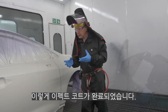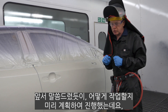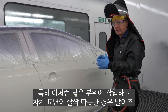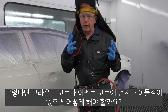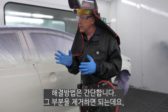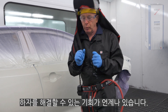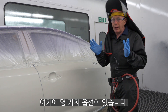Okay, so that's the effect coat applied, and as you can see, with a little bit of forward thinking and planning about how to approach the job — and the right product adjustment — it's not too difficult to do, even allowing for the fact that it's a large area and the car itself is slightly warm. I'm often asked at this point: what happens if I get dirt or dust in my effect coat? The simple answer is wash this layer off. You're not going to damage the layer underneath because that is activated and dry. So you've always got that opportunity. It's time now to flash this off to get ready for clear coat.